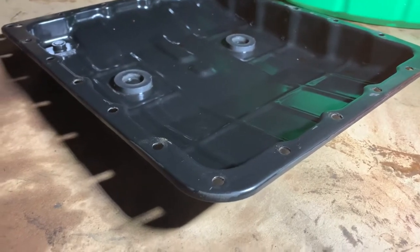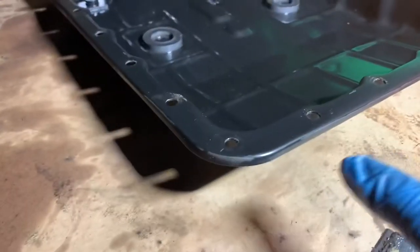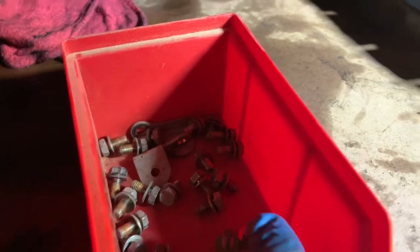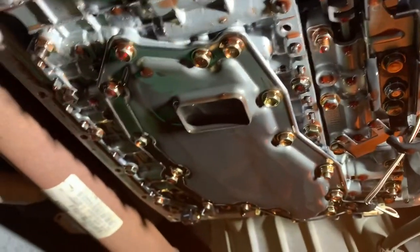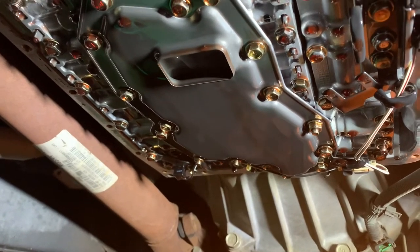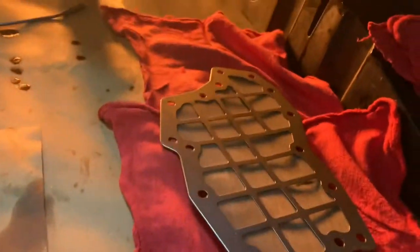We took the drain pan and scrubbed that edge — I used a blade to get the old seal off and then scrubbed it with a little sandpaper, wet sanding with some brake cleaner to get it smooth. You also want to make sure you bag up your bolts so you don't mix up the pan bolts and filter bolts. The filter uses different hardware — some bolts are different lengths and there are also some nuts. My recommendation is to use the old filter to track the bolts: take them out one for one and put each bolt back into the same hole on the old filter.